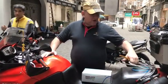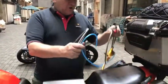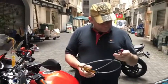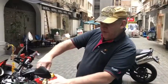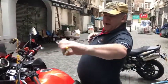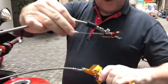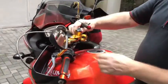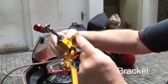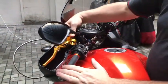One of the things is that I went on Taobao — AliExpress — and I thought, clutch conversion, I'll order a clutch conversion. So I ordered one and I got this: it's a clutch lever that goes on the handlebars, and the other end has this plunger on it. When I pump it the plunger will go in and out. But I realized it won't fit because they have a single-bolt assembly here, so to put this on I'd have to remove the whole assembly.